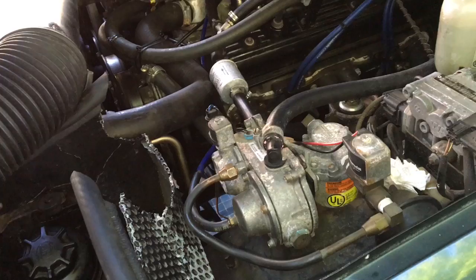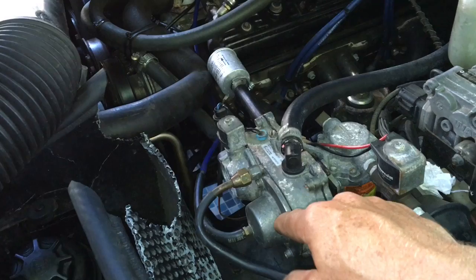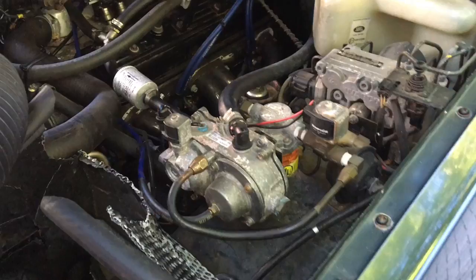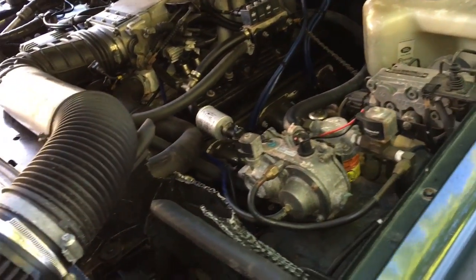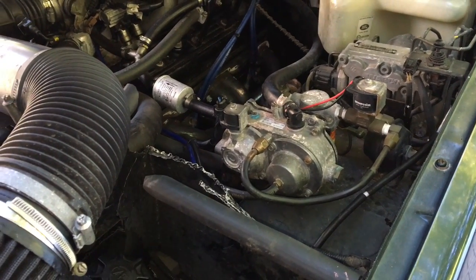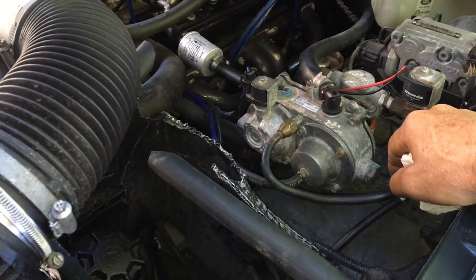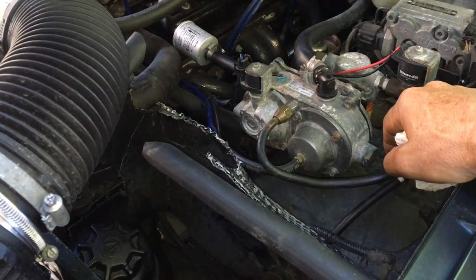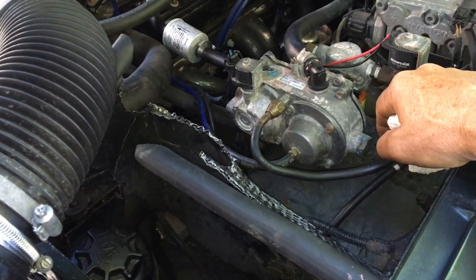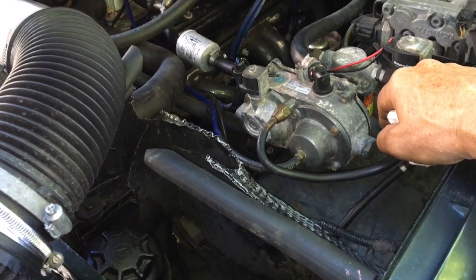You need to fairly regularly change the filters. The only other problem I had was one of the senders on one of the gas tanks got a bit sticky - it was possible to take the sender off the tank and unstick it. Really the two main things that can go wrong with LPG are just the injectors and the vaporizer, particularly the vaporizer diaphragm. Neither is particularly difficult to fix, so have a go, do it yourself, save yourself a fortune. If you don't fancy it, pass on the tips to a garage. I'm hoping they improve the design of these things over the years, but they look basically the same when I look at pictures of the new ones. Anyhow, that's how to keep it running and fix the two common problems with this OMVL Dream 21N LPG system. Good luck with fixing yours, thanks for watching, bye.